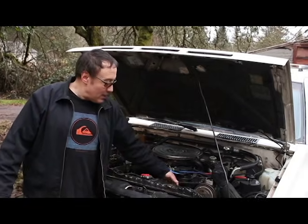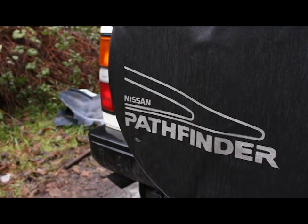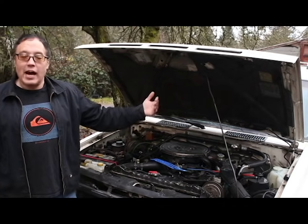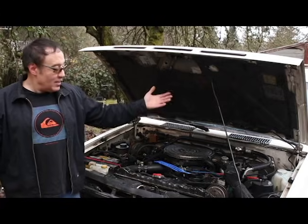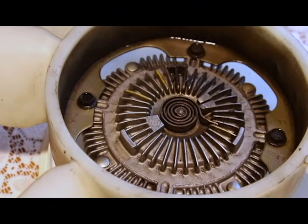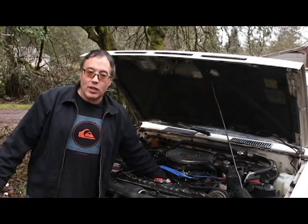The reason why I did this is because on my 1988 Pathfinder, in the summer when I had the air conditioning on, the temperature on the gauge would rise yet the fan would not engage. So I replaced the fan clutch probably three or four times with a factory unit and it still didn't work.